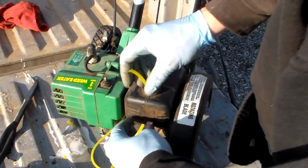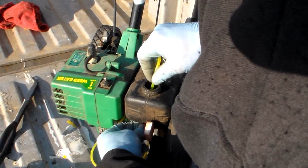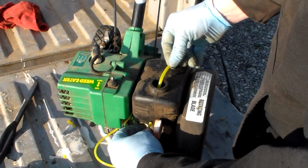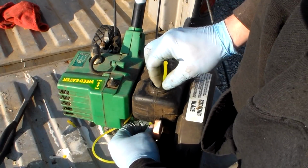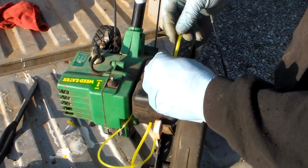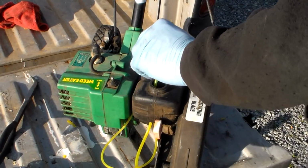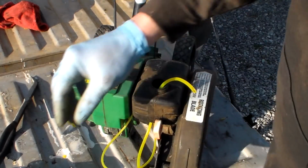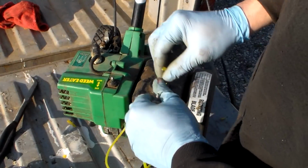So this is what I did wrong the first time, and I had to just go back and redo this. I didn't pull the fuel line up, because this filter has to lay on the bottom of the tank, right? So I didn't have enough, so it was kind of sticking up. It has to lay over, it can't stick up, right? So anyway, where's Musty One to tell jokes when you need them? So let's do this again.